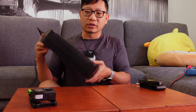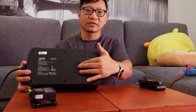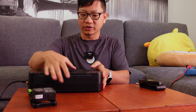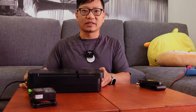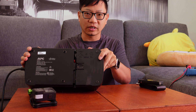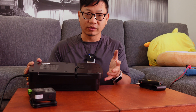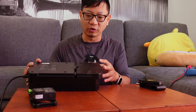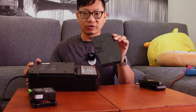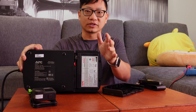This particular model makes it super easy. There's actually a slide-out section over here — there's a little tab I push in and then you can see the battery. I'll slide this out and it's that simple. Some units will require you to remove some screws in order to do so. You can usually look on the bottom of the unit or in your user guide about how to open it up. I recommend getting ones that are replaceable, and this one is very easy — literally just a cover that you slide out.